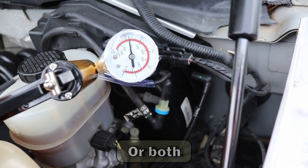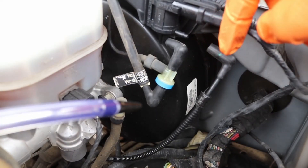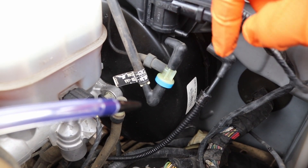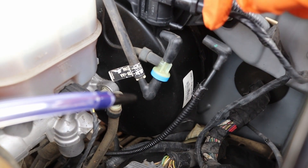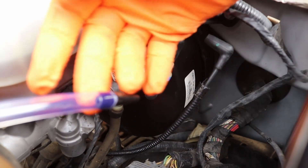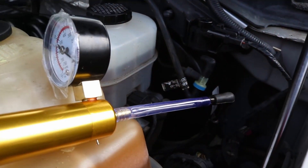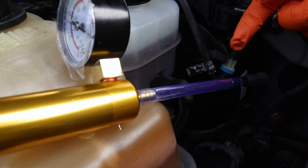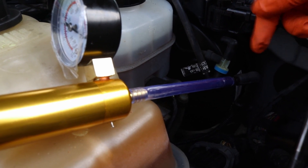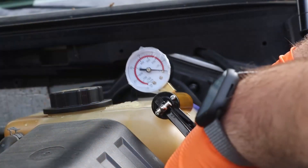It's either going to be the IWE itself or the vacuum line going to the IWE. Here's the vacuum tube that hooks up right there. We're going to apply vacuum here and see if we can actually hold a vacuum in this tube or if we're losing it somewhere. Using the cone adapter, you always want to test your tools first — stick your finger over the wedge, pump it up and make sure it holds vacuum, so you don't accidentally make the wrong diagnosis. Okay so we're at zero.